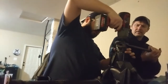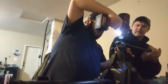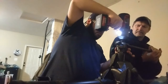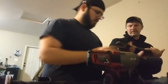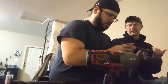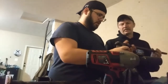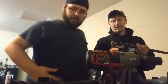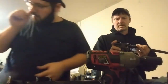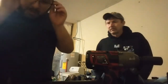Just a little bit of play left. All the play is gone. Sure. Yeah. There's no play. I mean, we can take this tool off and double check. Here, let's go ahead and pull that off. Let's do that real quick. We're going to check the preload real fast. It feels like it has a little drag on it already.